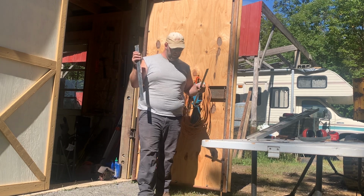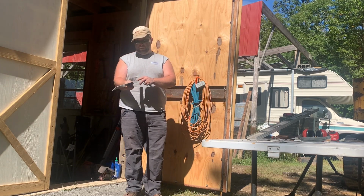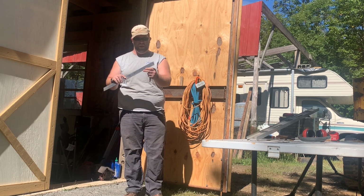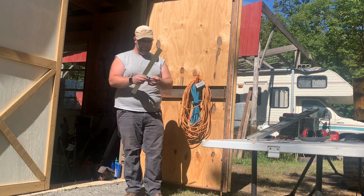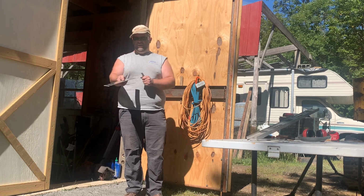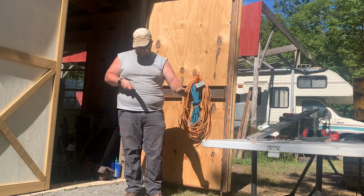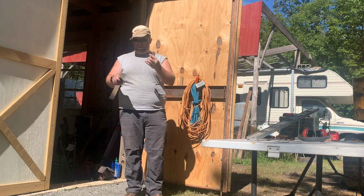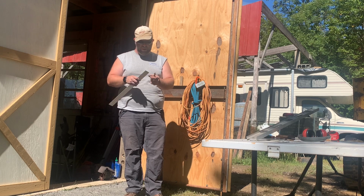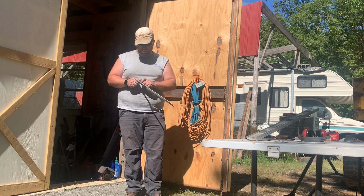Anyways, the last thing I wanted to mention about this aluminum is when you cut it with the cutoff wheel, you get a really gnarly looking burr here. It sticks down about half the thickness of the plate here. I used to run a hand file, draw file it, use a rasp, you know, whatever. But I found recently that if you just take a utility knife, words are tough, take a utility knife, it cuts that burr right off. You just go down there and strip it like you're stripping out some wire. Look at that.